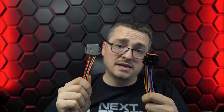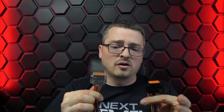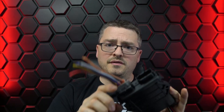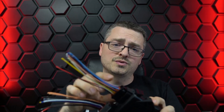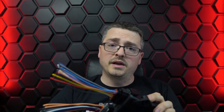For those, you have both pigtails. Now, keeping in mind on these controllers, the pigtails are sold separately. They're fairly expensive plugs. It is something that you might be able to potentially find online for a cheaper price, keeping in mind that these are not standard plugs. They are very specific to the actual plug on the controller itself. So you do have to make sure that these detents all line up with the controller and snap in. So if you go online and find something, be very careful that it does have the proper lineup for the holes so that they snap in. Obviously, if you get the plugs from us or Glowcraft directly, that won't be an issue — they'll plug right in.